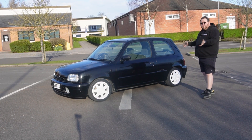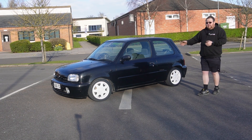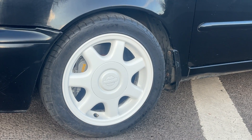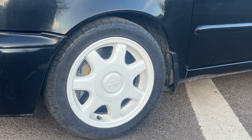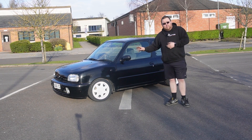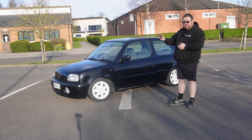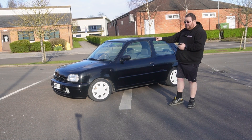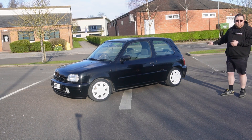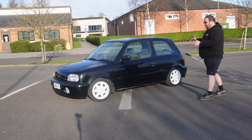It's a Super S model, which means as standard it comes with a disc rear axle — so we have front and rear discs. On the fronts, we have an upgraded AP four-pot system. The customer has already taken into account the additional power, so the brakes have been upgraded to suit. It's a fantastic kit by AP because the cylinders are perfectly suited for the factory master cylinder. On the rear, we've got upgraded discs and upgraded pads.